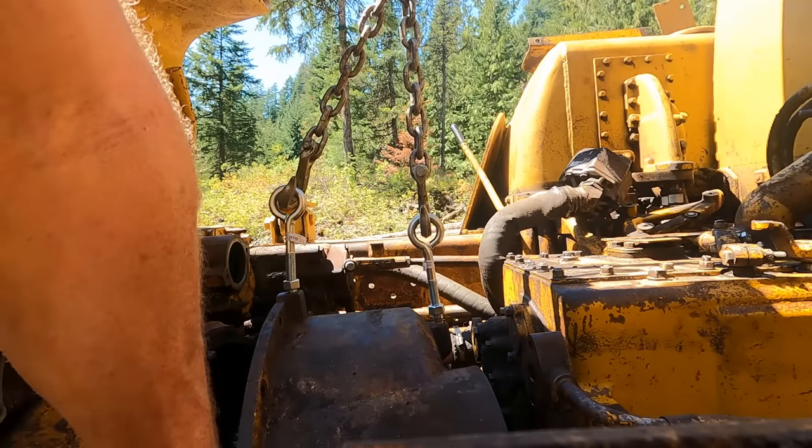Looks like Riley's already made a discovery — this shaft is able to slide out and I don't think it's supposed to. Oh, that's the broken seal! The seal is broken — that's it! That is definitely a problem, but I think this is good news. This rides inside here and seals against oil. Now I'm looking at the housing — this is the part where it apparently cracks, right in here. We're going to rotate this around looking for cracks. Something hit it right there but that doesn't look cracked. My biggest fear was that the housing was cracked but I think it looks okay — I think it's just the seal.